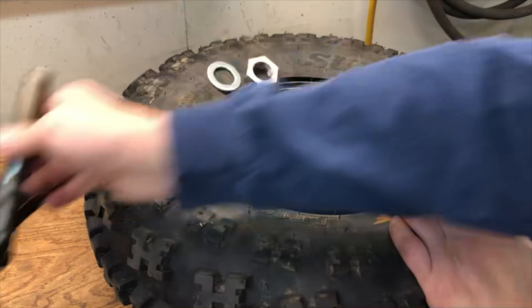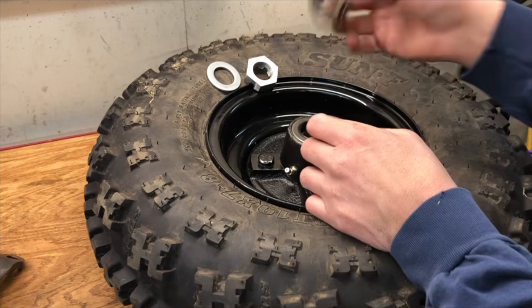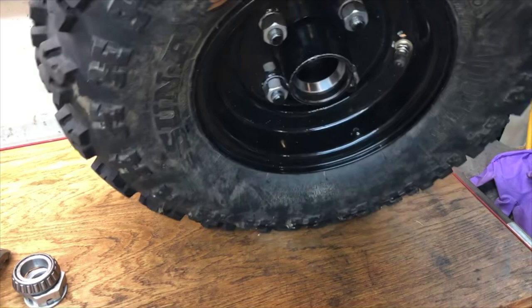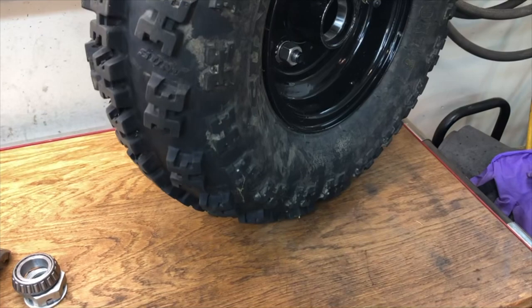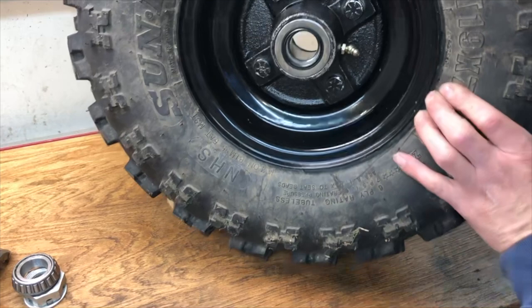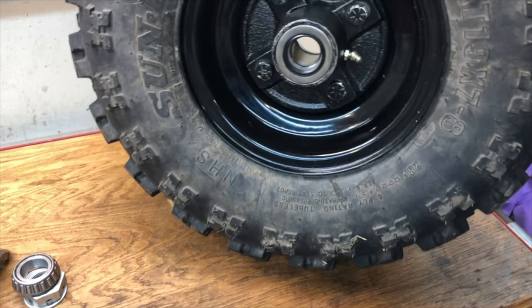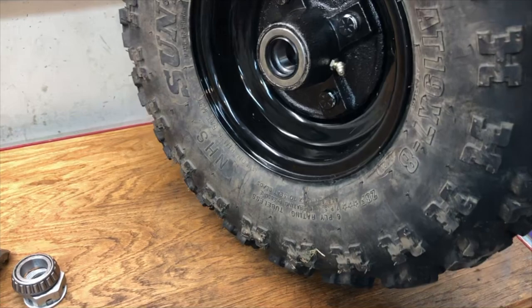What's really nice now is that I get tapered roller bearings that are way better than the chintzy ball bearings. I can pump them full of grease and they can take way more load and heavy duty use. Now I actually have hubs so I can take my tire off with 4 lug nuts to do any maintenance. The other big advantage is that on a mud tractor the center of gravity is a little too far back, so having these heavy duty hubs up front kind of adds some weight up front to help keep the front end down and put weight right over the centerline of the tire to really help it steer better.